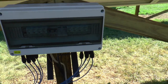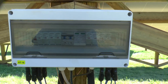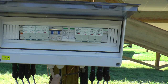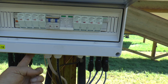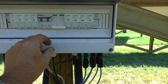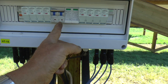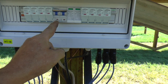This box was big enough that it had extra space, so I was able to put another fuse on for the plus and minus on each side — so I've got five fuses in this box. The reviews were kind of mixed on it, but I thought I'd give it a shot. The circuit breaker was over here where the surge protector is, and they've got the wires coming in over here, and the other one was way over there. I'm using number four wire so it's kind of stiff. I would have had to make a turn and come all the way over, so I traded places with them — that put the original one coming right in. Then I just put a new hole here so it comes up with just a slight bend in it.